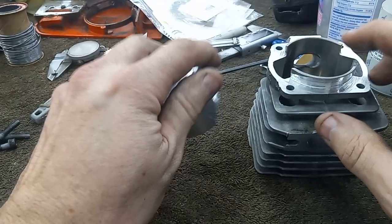There's the upper transfer where I epoxied it. There's no ledge there — it just comes down and goes right in. And then I winged it just a little bit on each side right here to make the transfer a little wider and to get it to flow where I wanted it to. On these open ports, I lay tape across here and leave a gap about like what a normal transfer gap would be like, then flow water into it to see what they're doing, and do my adjustments from there.